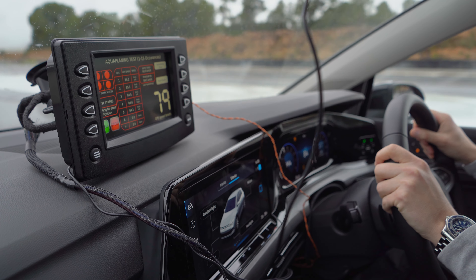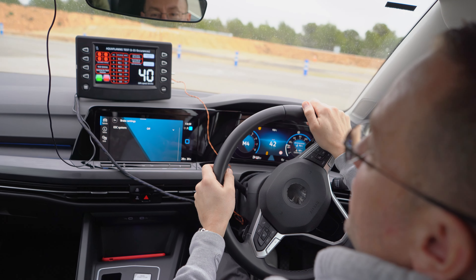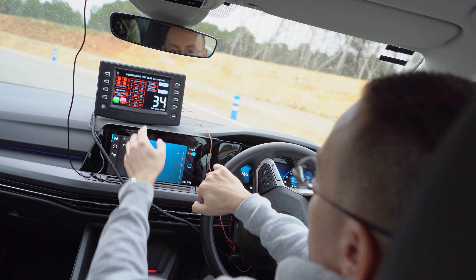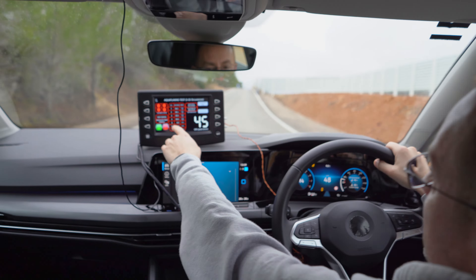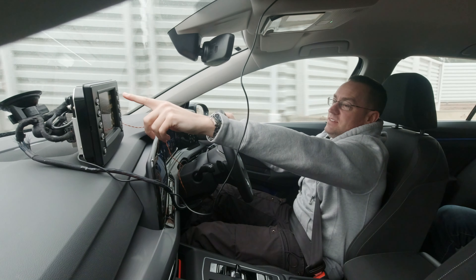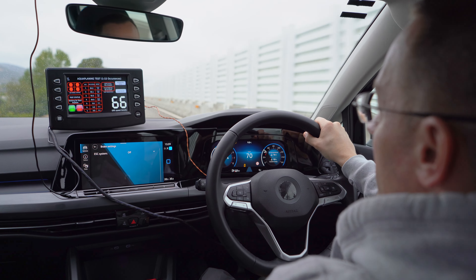This also gives me additional information about the tyre. Not only is 84 km/h quite an effective speed for a tyre of this size and type, but the consistent grouping tells a story. If a tyre were jumping up and down in results we'd know there are problems with it. This very nice, close, clean grouping confirms the tyre's quality. One more test and we would be finished.